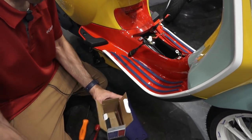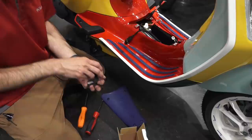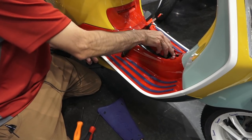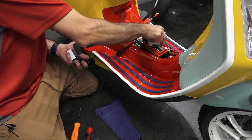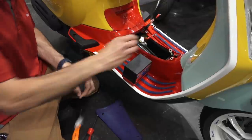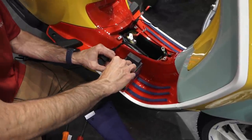The one main difference with installing the battery on a Sprint or Primavera is: if you drop this battery into the tray, it's going to drop way too far down. So we're going to need to put a couple spacers — pretty much the whole set — that fit this battery. Take these foam blocks and go ahead and adhere them to the corners of the battery.